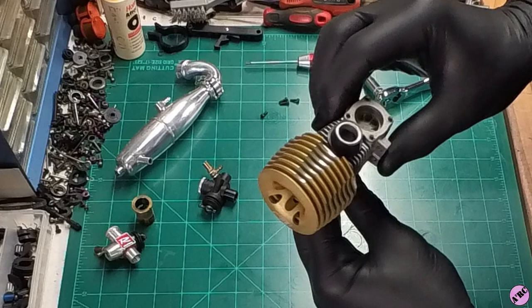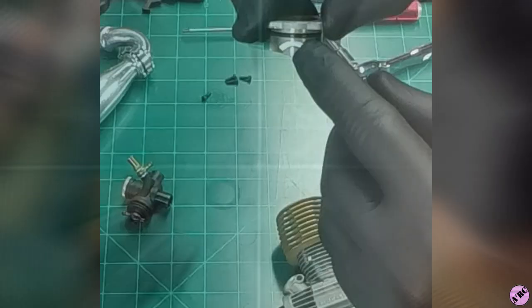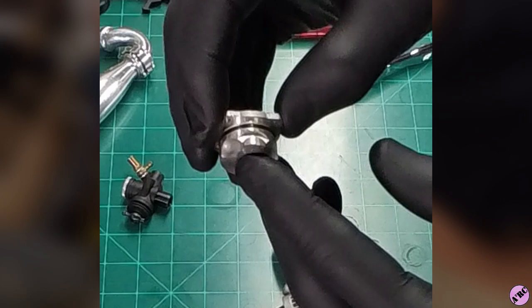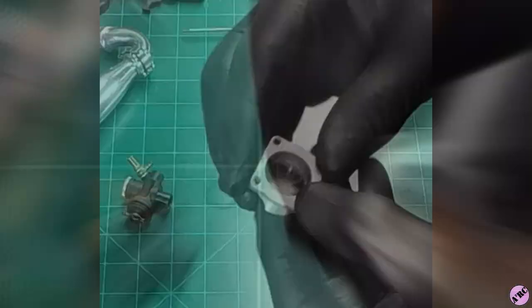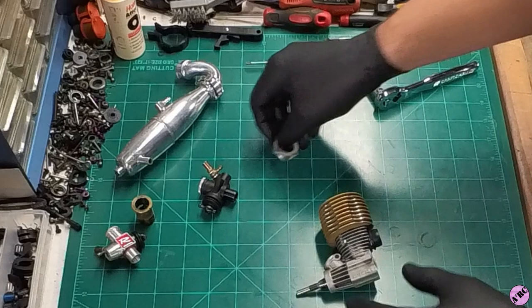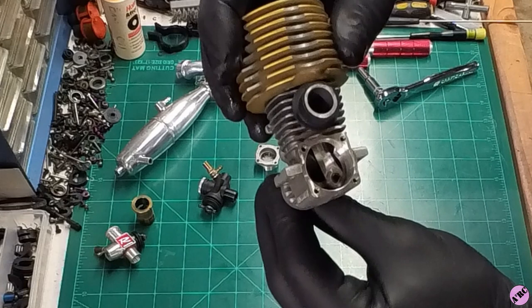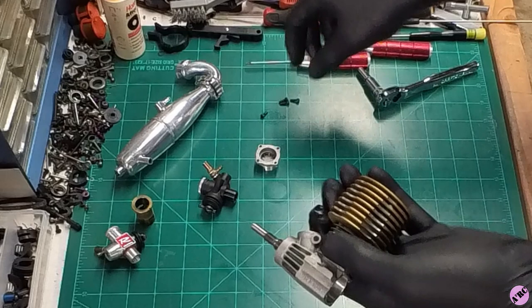Let's move the piston up a little bit and take off this back plate so we can take a look. The back plate is an interference fit — notice the groove and interference back plate with a nice O-ring. There's a little indicator on top for up. This is a cast aluminum back plate that's been machined. Inside we can see a billet rod that's been machined, with brass bushings. The back plate bolts are M2.5.